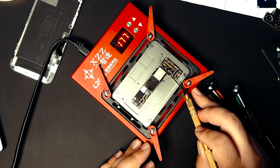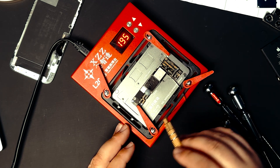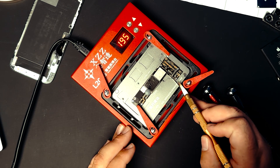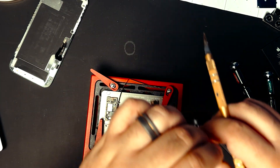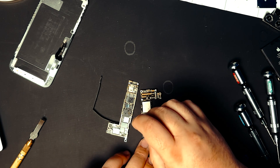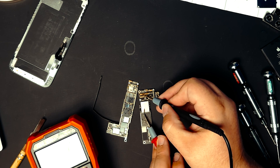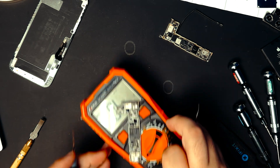I can see the flux from the factory interacting with the edge, so we're getting close. I've put little clamps on here to help hold the board down. We're up to temperature so it should start to move when I tap on it — this side's lifting — and it's off. I'm going to take a fan and let things cool down. Let's test and see if we still have an issue with that line — look at that, we are testing just fine. Very interesting.